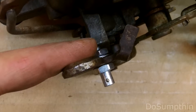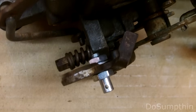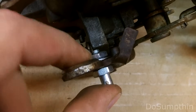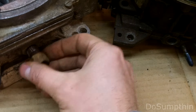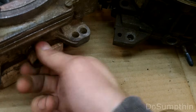I just installed the little throttle cable adapter and I used some Loctite on it and just snugged it down. I heard that these are actually pretty weak and strip out easily. I used a three-quarter inch wrench to loosen this fitting for my brake booster and I'm gonna swap this right over - same place on the Edelbrock, right on the back of the carburetor.